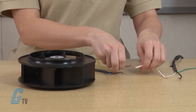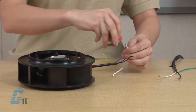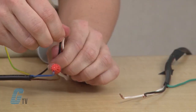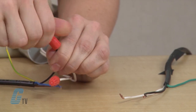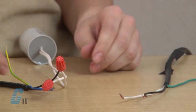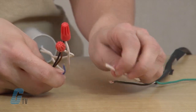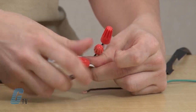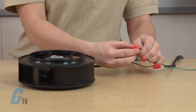For our wiring, I will not need the green wires. First, I'll connect the capacitor to the fan. Take the brown wire and connect it to one of the wires coming out of the capacitor. Next, I'll connect the hot wire from the fan to the remaining wire on the capacitor. Once this is done, I can connect the fan to the plug. I'll take our plug and connect the neutral wire to the blue wire on the fan. The last free wire should be the hot wire from the plug, which I will connect to the hot wire from the fan. This connection has a total of three wires.